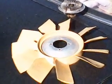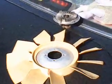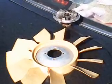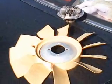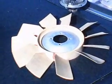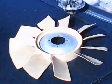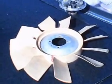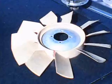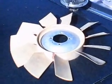But the nightmare we're talking about today is not related to the fan clutch. The fan clutch works just fine. It's a very reliable part. It's the fan itself which is the problem, and of course this is a Jaguar design manufactured by Jaguar. If you look at the hub, you'll notice that it's a solid hub and there's no cooling holes for the back of the fan clutch.